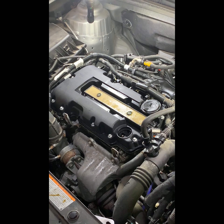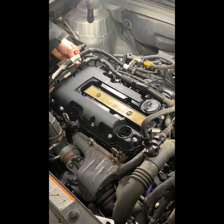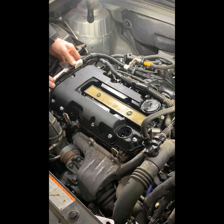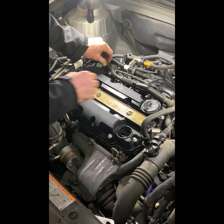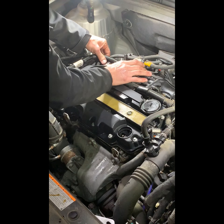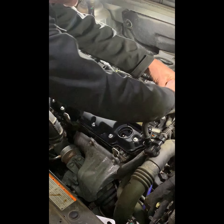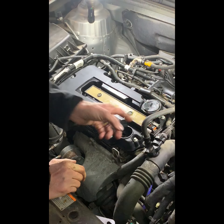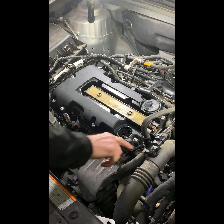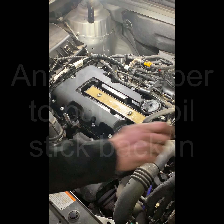All right, so I'll put the torque specs up on screen. Obviously you've got to put the dipstick back in, slide it down, get all your wiring back connected. There was one clip I need to get off the old valve cover — it doesn't come with the new one. Plug in your coil pack over here, lock your tab down. We'll stop right there — we're going to change this water outlet in a bit. Next video, if I get a chance to shoot that, I will.